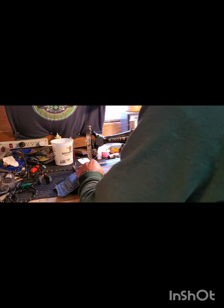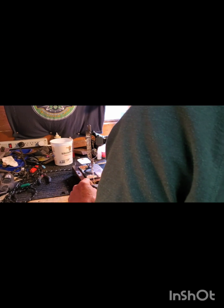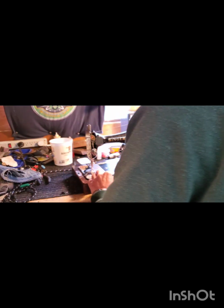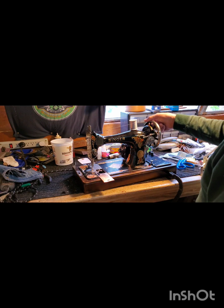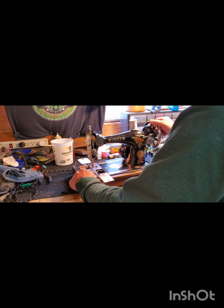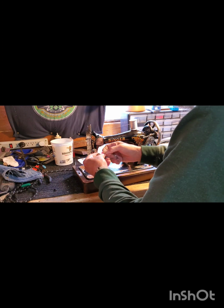And in this video, we're going to show you how to wind the bobbin and thread the machine, and how to work the various controls. So we're going to start by winding a bobbin. And you'll find your bobbin down here under the slide plate. Turn your hand wheel towards you until the shuttle carrier brings your shuttle and bobbin all the way over in front of you. And just reach in, get your fingernail under that little handle on the side, and lift the shuttle out.